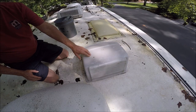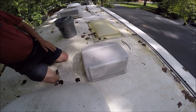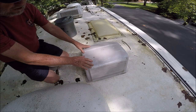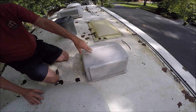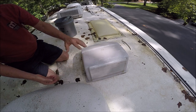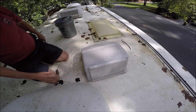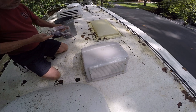We're on the roof. Here is the vent cover on the fan we're going to replace. Notice the back is facing toward the back of the motorhome, with the front going out this way. Observe how the vent is placed before removing it, because if you install it wrong you won't be able to open the vent afterward. Set it to the side so you can put it back on in the exact same way.